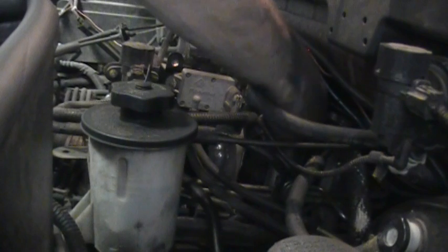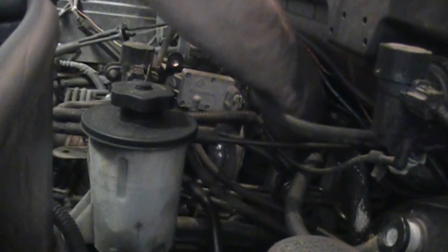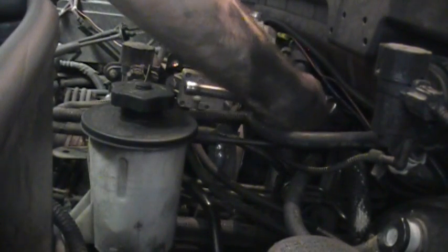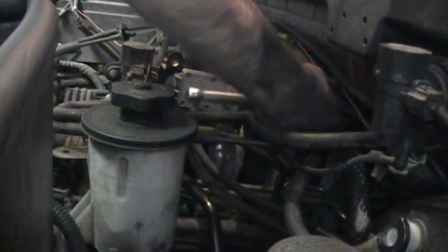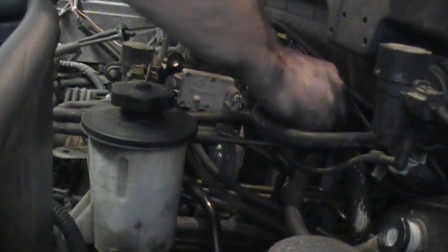Remember in the movie? Okay, so now that we got the brake booster line in and the bracket sitting on the stud, now we got to put the single 10mm nut that goes on that stud and bolt it up. Once again, don't go too hardcore on this. All it's doing is just holding a bracket on. There's no sense in killing it.